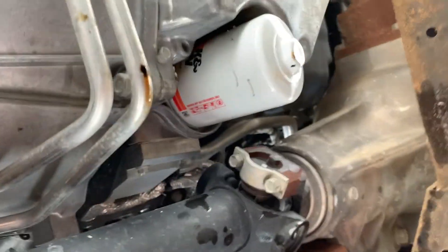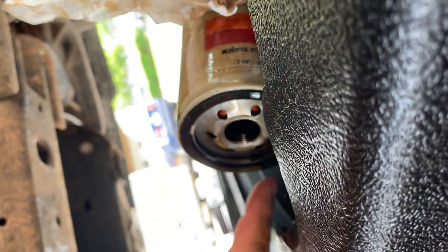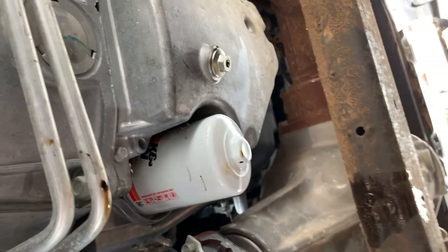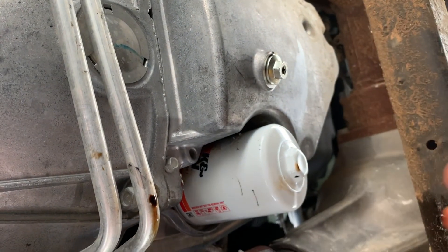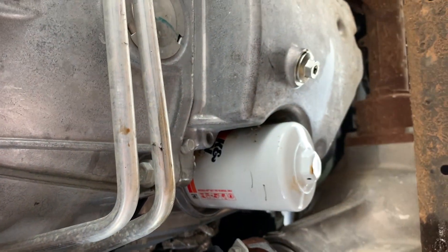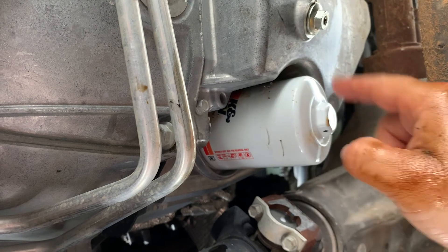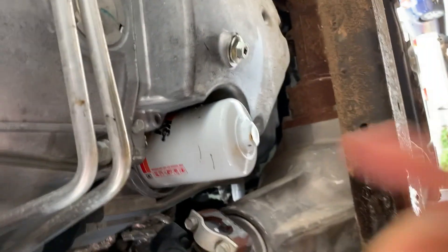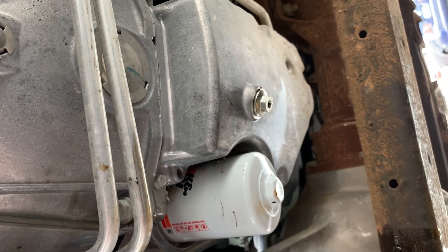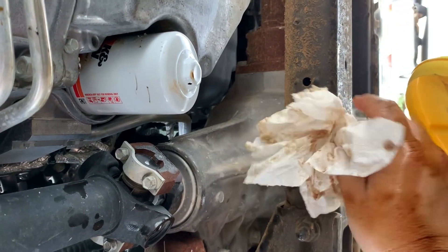Real quick before I get from under the truck — on the new oil filter, you can see there's a rubber seal that goes around it. Always take some oil — I take it from the old oil — and rub it around the seal before you put it on. That helps it seal tight. And the reason I wipe everything off is just in case I make a mistake — if there's a little bit of an oil leak, now that it's clean, I would see it dripping down. That's why I always wipe it off.